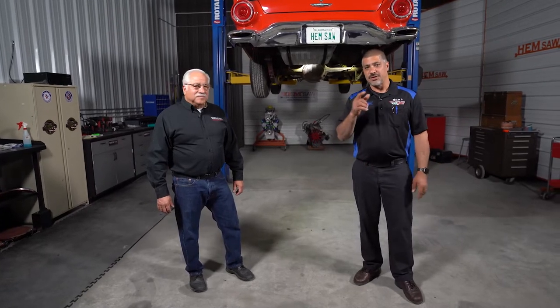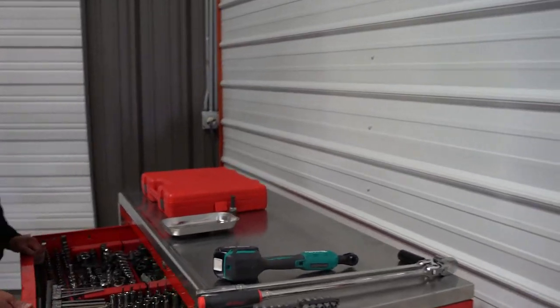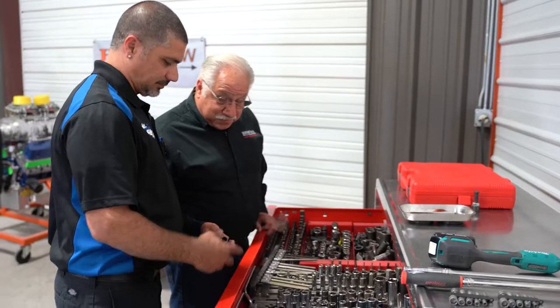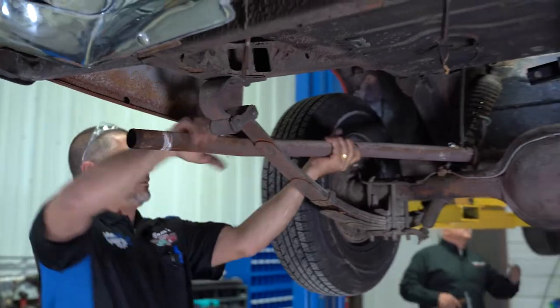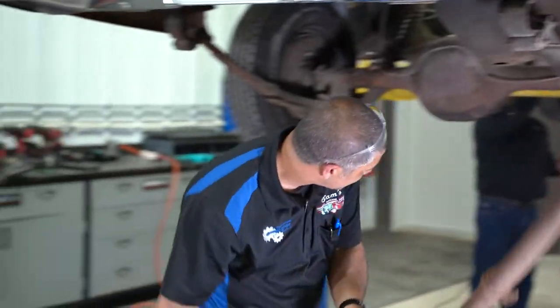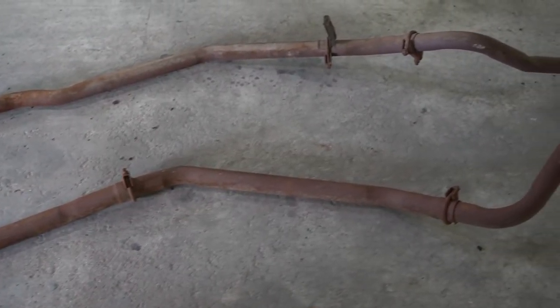While we're doing it, we're going to upgrade the front to a whole new suspension. We went to Scott's Hot Rods and got a whole new front clip. We went to Moser and got a whole new rear 9-inch housing, and we're using Scott's four-link conversion for the rear. If you've driven one of these old Thunderbirds before, they've got a wonderful look, but it drives like a 1957. When we're all done, it's going to drive like a modern car today — and you're never going to be able to tell because from the outside it's going to look exactly like a 57 Thunderbird.